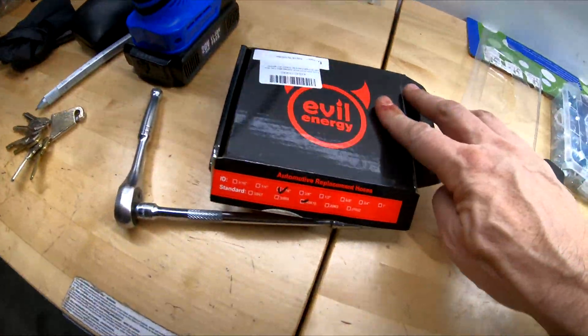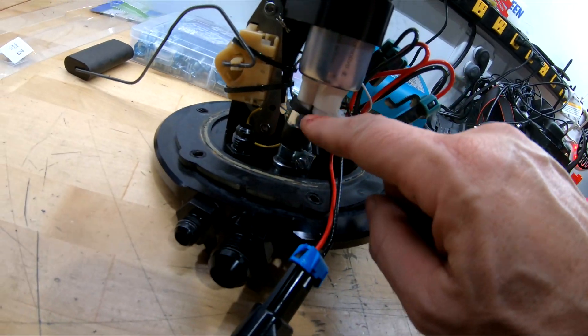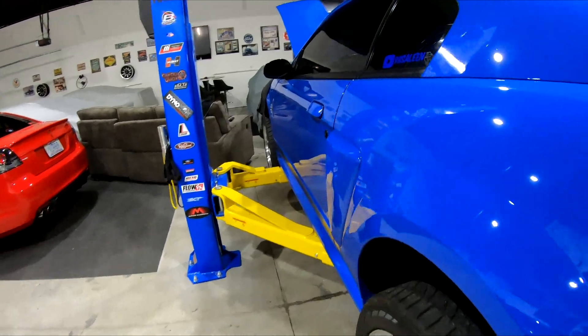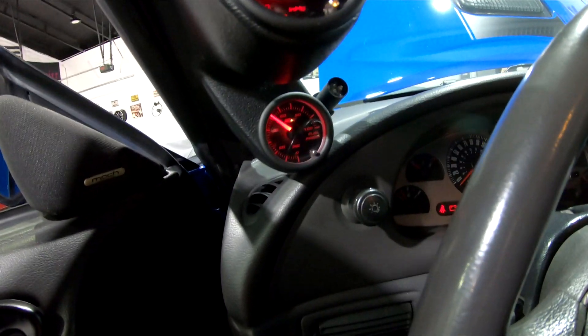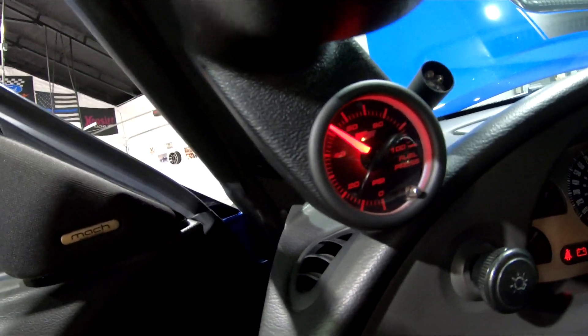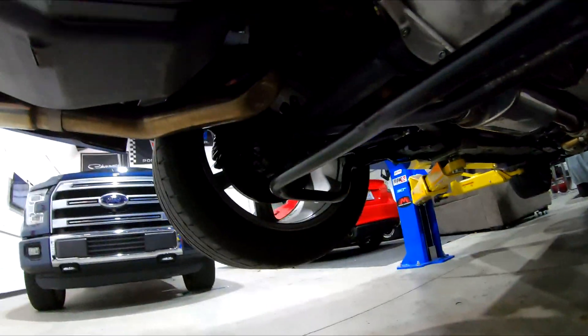Got my pumps mounted, finally got in my submersible hose — wasn't much but it finally came in. Used some new clamps to clamp it all down. Got the pumps back in, got the tank up under the car, hooked up the battery. Getting ready to turn the key on to see if it's going to prime the pumps and if I've got any leaks. Pumps are primed — putting out about 50 pounds. No vacuum at 50 means you've got to adjust it down, but that means those pumps and lines are working really well. No leaks — you can hear it going through the filter, nice and dry.